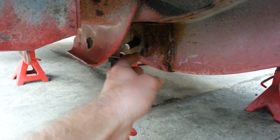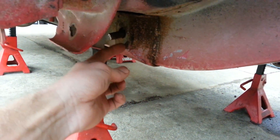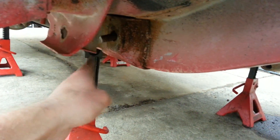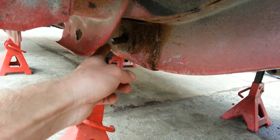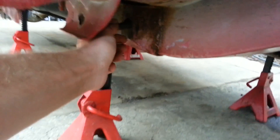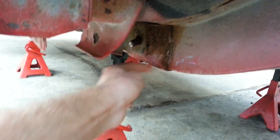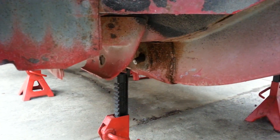So what I want to do is cut down from the bolt hole itself, pry this down, take that bolt and nut out, and try to put a new bolt in with a new nut tack-welded in. It feels like there's dirt and stuff in there anyway, so it's probably best to cut out the bottom so stuff can't collect in there anymore.